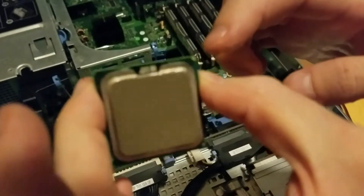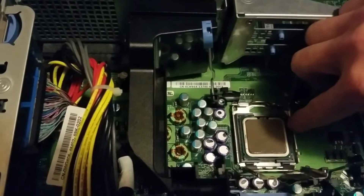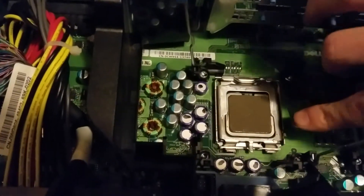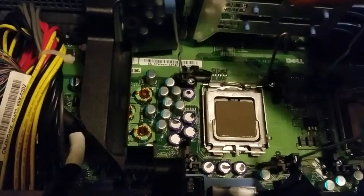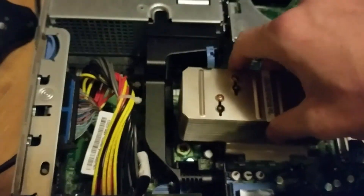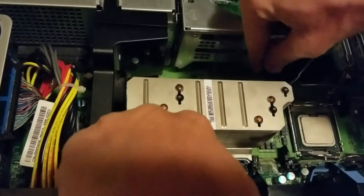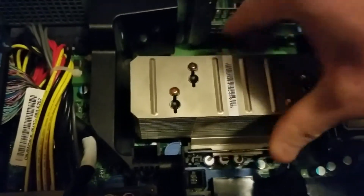And then, back to the corner thing — there's your little diamond corner. It goes in like so, and it's just resting in there now. I can nudge it with my fingernail. Drop the little latch down. I'm just going to take this heat sink — it's all clean — and put it on there, just so it's resting, as evenly as possible. I'm going to get these clips down here because this is what's going to make that work together, keep it on there nice and tight. Doesn't wiggle — we're good on that side.